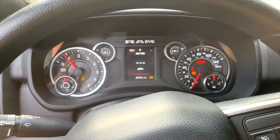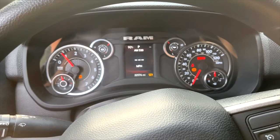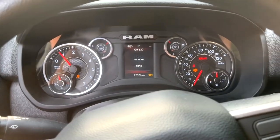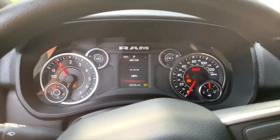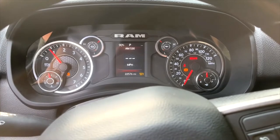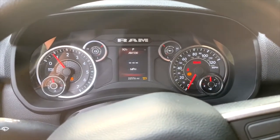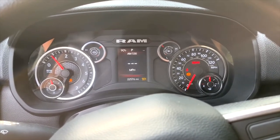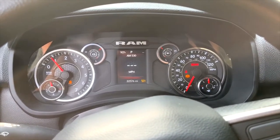That was interesting. I was following the instructions and suddenly I got a lot of warnings on my ABS system. The ABS system light is on, brake light is on, rear parking sensors don't work, and the sway bar is messed up — the ABS is off. So that's a problem. Let me see if I can put it in a different jumper port and make sure that the ProCal hasn't goofed anything up.